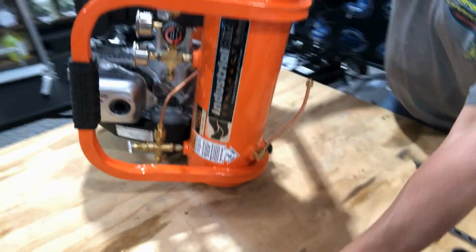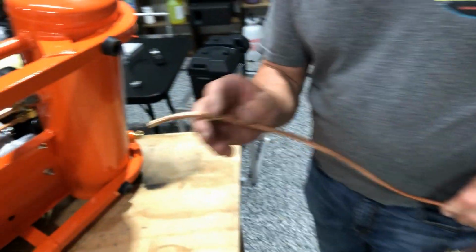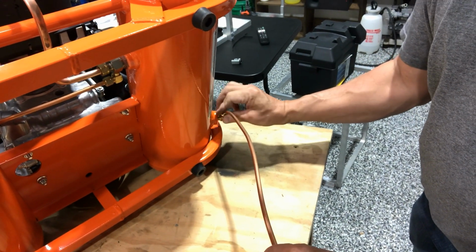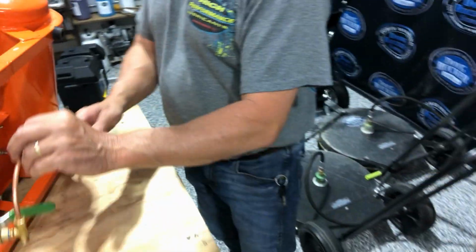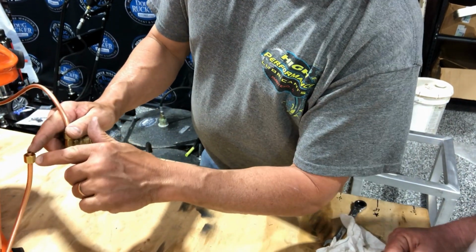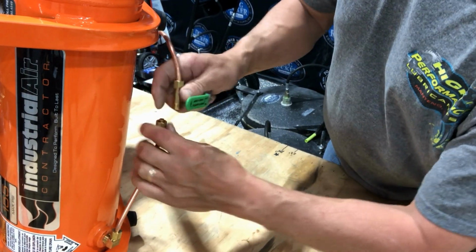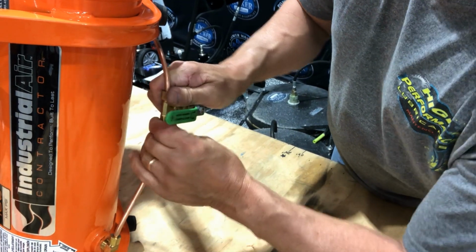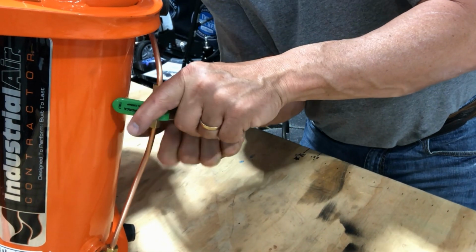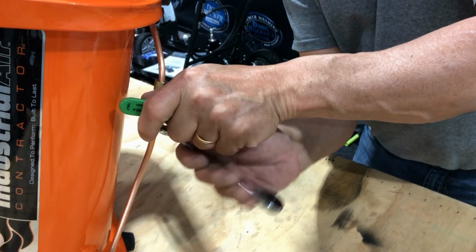Roll it back up again. You'll take the long piece, and the ferrule end goes right down in there. Now it's all loose and you can move everything. This is loose here, this ferrule's loose here. Now you're going to put this last connection right here into this T. This is already assembled with Loctite and everything, and you'll get that going on there. Now this, when you get going, is a 1/2-inch wrench. And you start snugging everything up.